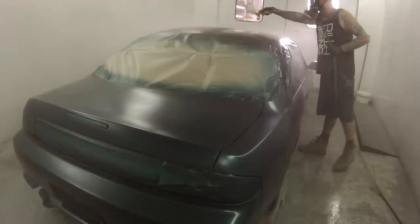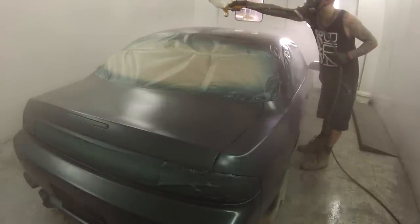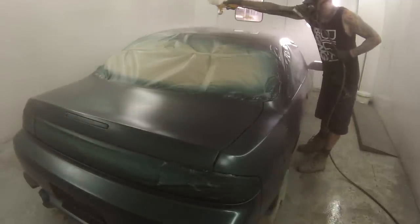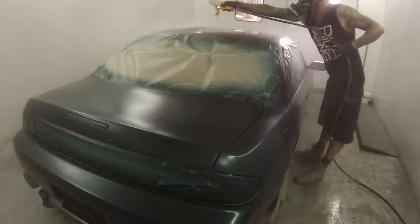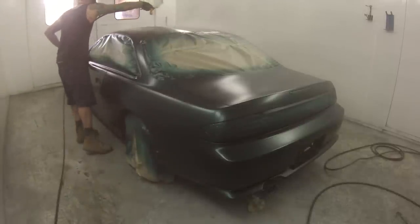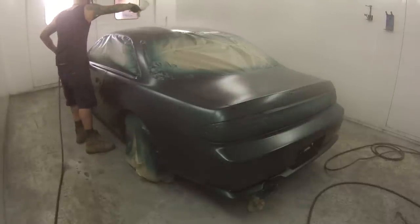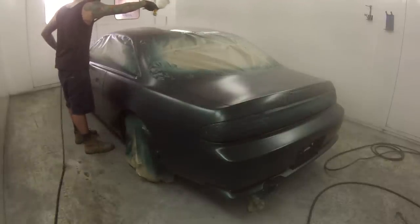But yeah, onto our clear coat now. First coat of clear, I'll put you on the tripod. Second coat, again, I've got you up first person view. So again, just take note of where I'm starting and finishing. I've just come down those pillars, just down the windscreen and the rear pillar there as well, the rear windscreen pillar. And yeah, that's a small area. It's the only spot that's going to be a tiny little dry spray, as well as this quarter panel.